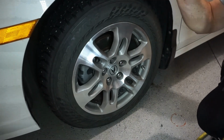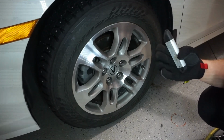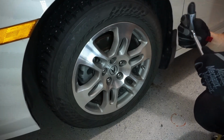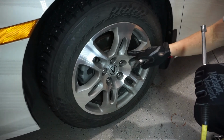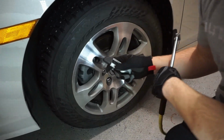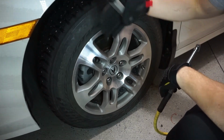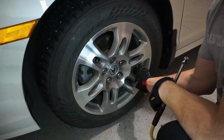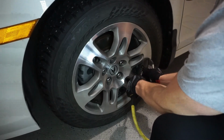But since I know that the outside is going to be colder, and if we drive and park in a parking lot and it's minus 20 out, and my garage here is heated, it's plus 12, plus 15 in the garage, I'm going to want to fill this pressure up a little bit higher. So I tend to go 1.5 PSI higher because it is hotter here. And then when I go outside and get in the cold, my tires will deflate a little bit. So I will actually take this to 37.5 all around.